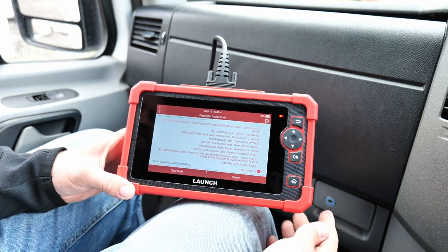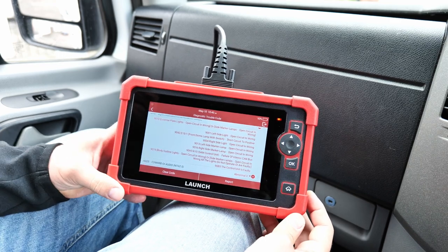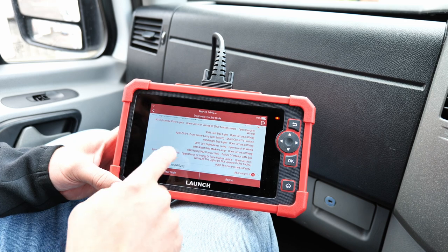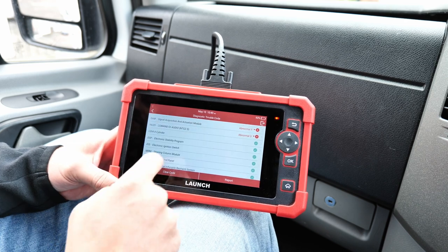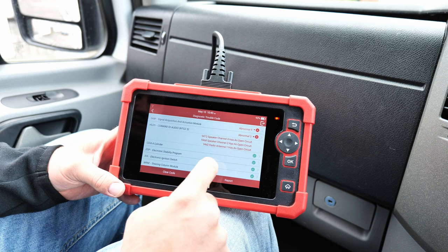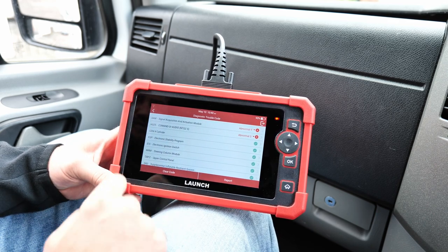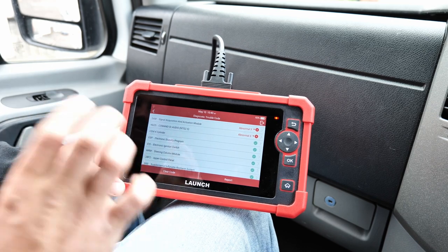The report shows all the faults on the car. We've got a signal acquisition problem — I put LEDs on all the side lights of this vehicle and they're not CANBUS-compliant, which is why they're showing as errors. Also, speaker four, speaker two, and the antenna has an open circuit on this van.